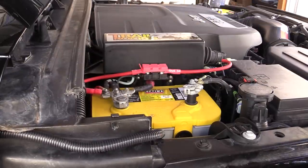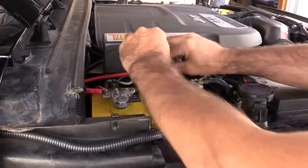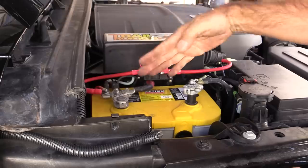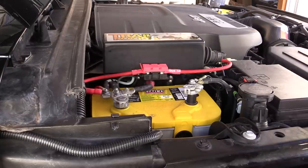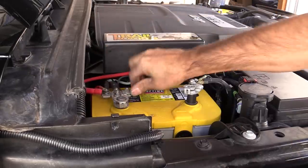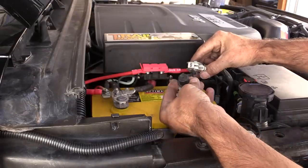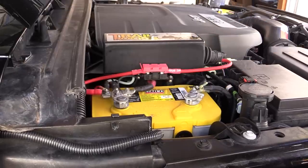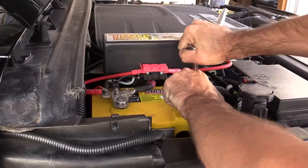This right here is a 200-amp breaker fuse, and that feeds the Trail Rocker relay panel. Everything looks clean — we have my winch, Jeep accessories, rugged radios, and the Painless system all tidy. We'll tighten the positive down, put the negative in place, and we've now energized the system. No smoke and no problems — that's a good thing.